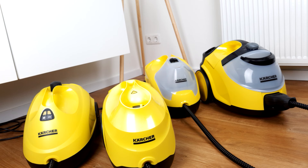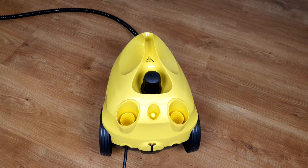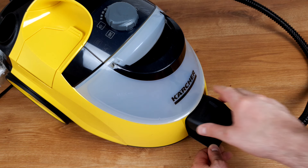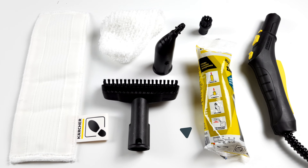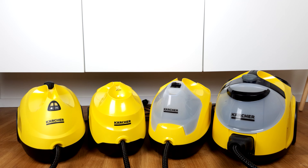When it comes to storage, the SC appliances don't have too much in common. The base can be locked into the parking position and there is an accessory storage compartment on the appliances. From the SC4 upwards, there is also a cable compartment, and the SC5 has the useful feature that the steam tube is detachable, allowing it to be stored in a particularly space-saving manner. Unfortunately, only the SC3 has a proper descaling concept and already includes one descaling cartridge. The appliance even reminds you to change the cartridge through an indicator light. With the other appliances, you unfortunately have to prevent the build-up of limescale yourself or carry out the descaling manually.